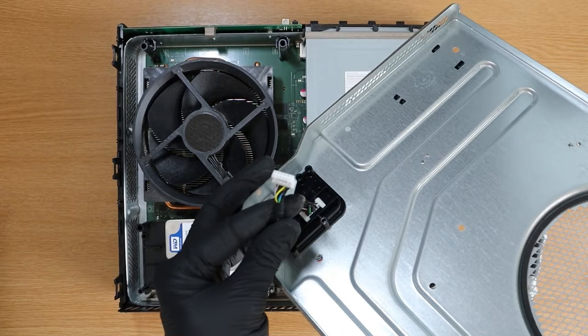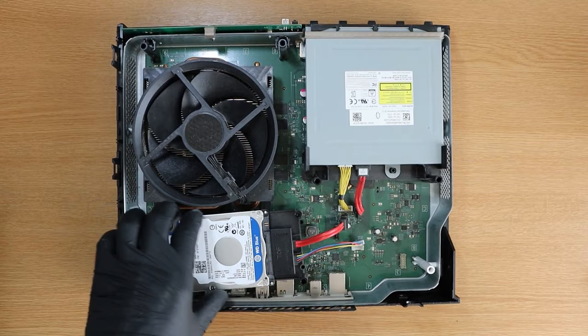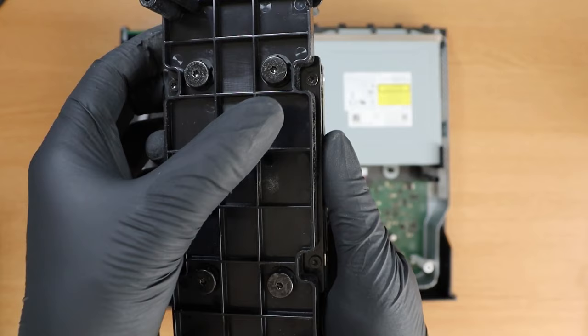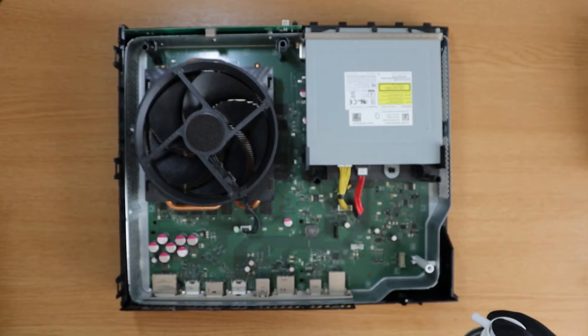This is just a quick side note. This video isn't to show you how to change out the hard drive on an Xbox One, but whilst we're here I might as well tell you real quick. There are two cables: the power cable and the data cable. You unplug them from the motherboard, lift the stand that the hard drive is on, unscrew the four screws on the back side of that stand, swap out the hard drive. Bob's your uncle. Back to the dusting.